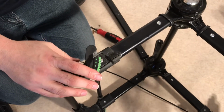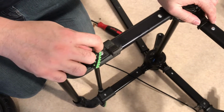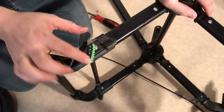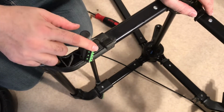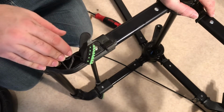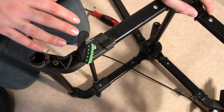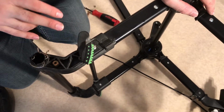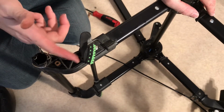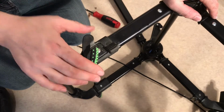Now the brake shoes. If you have trouble with the brake shoes, this will generally be that either this top green element, they've changed the color over the various generations, but it's in two parts, has either fallen off or it's worn down. These teeth are no longer catching on the inside of the wheel, and for all of these reasons, you might need to replace the brake shoe. These are side specific, and of course the one side has the extra little thing for connecting to the spring.